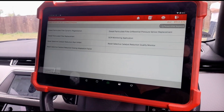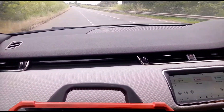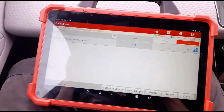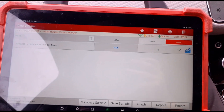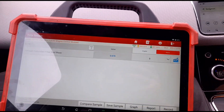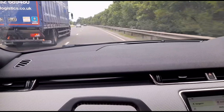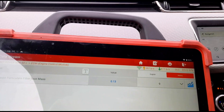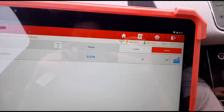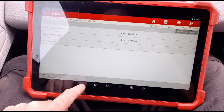There was an error so we tried again. The soot dropped straight away from 16 grams down to zero and said it was complete — it didn't drop slowly, just rapidly to zero. We then took it on a 10-mile drive to see where the soot mass lies. We're now at 0.279 grams after the drive, so it's not increasing rapidly. The fault code hasn't come back.